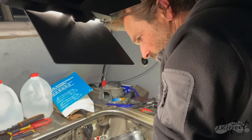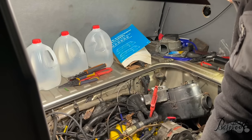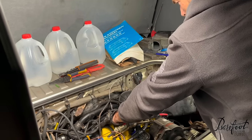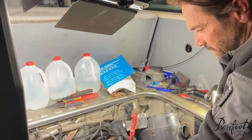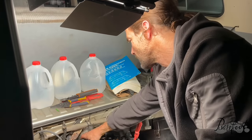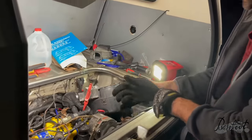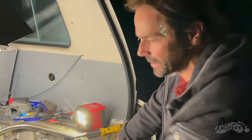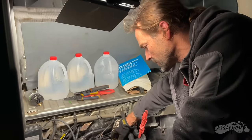So that's a pink size, not a blue size. Just waiting on that timer. 30 seconds, and then it recognizes the oxygen sensor. Just for idle control. Oh, okay. And I think I noticed that the switches stick when we first had it hooked up, so I'd rather leave it disconnected. I have the mechanical one we can change out. That sounds great.